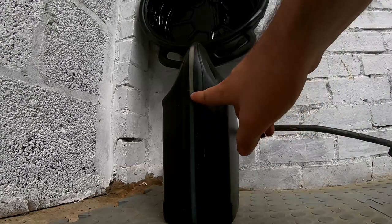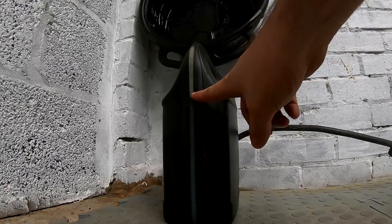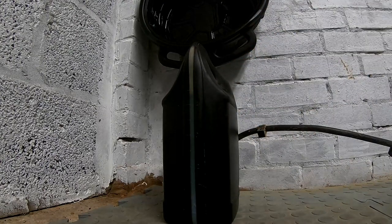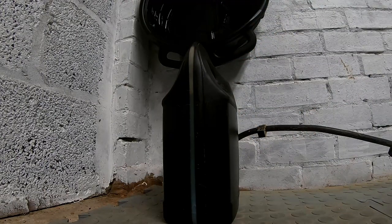You can see we are very, very close to the 4.5-litre mark in the bottle. So exactly what we're going to do is put four and a half litres back in. As I said before, this is not the factory method — I don't condone this, I'm just telling you the way I service this gearbox, and this is all at your own risk. I'll show you how we can refill this box without any special tools.